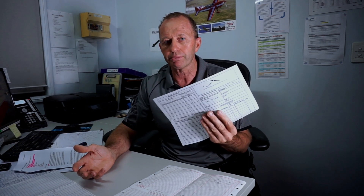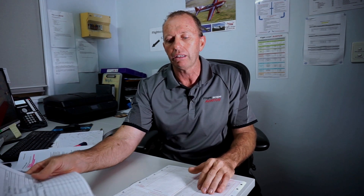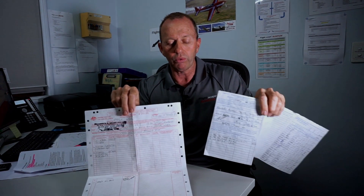One thing that stands out is that the maintenance form for an RA-Aus aeroplane — our RA-Aus Eurofoxes for instance — is 100 hours between services. There are other things that come up earlier, like the Rotax 50-hourly service for oil and the oil filter. Whereas with a CASA-style Schedule 5 aeroplane, we can actually overrun the 100 hours by 10% to 110 hours sometimes — not in all cases — which means the next 100-hourly would be a 90-hourly, so you still do two 100-hourly services per 200 hours. We actually don't use the Recreational Aviation Australia maintenance form available on their website. We prefer to use the CASA-style form — we've got the ProAV one here, a multi-segmented form, much like the CASA one we're using for the GA aeroplanes.